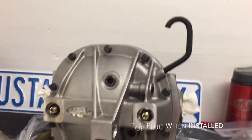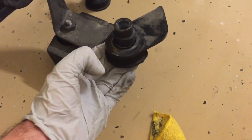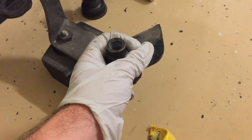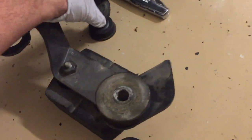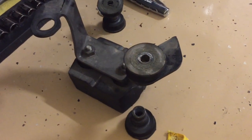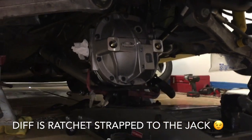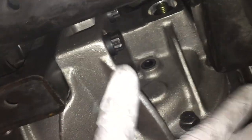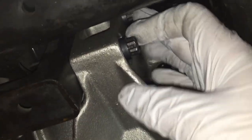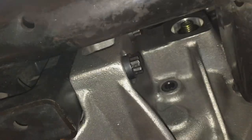The orientation for the bushing: the stock bushing goes under here, then through the actual differential, then you put on the top piece and a washer goes on top of that. I'll show you again when it's in the car. We just wheeled the transmission jack under here with the differential on it, lifted it up, and secured it with the rear two bolts. There's some give in the bushing — it allows it to rock a little bit.